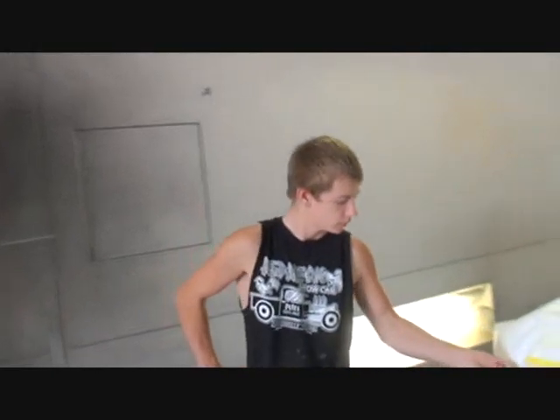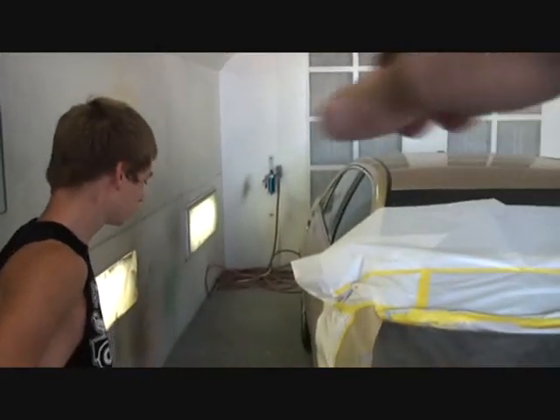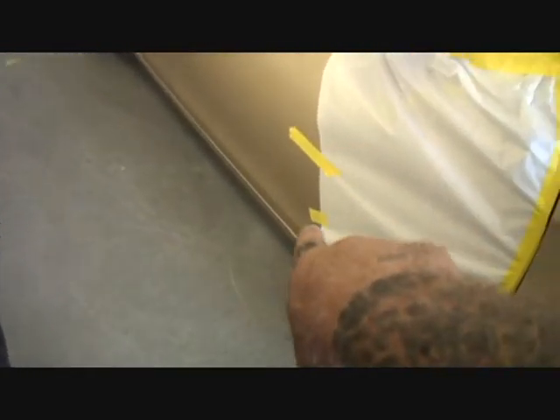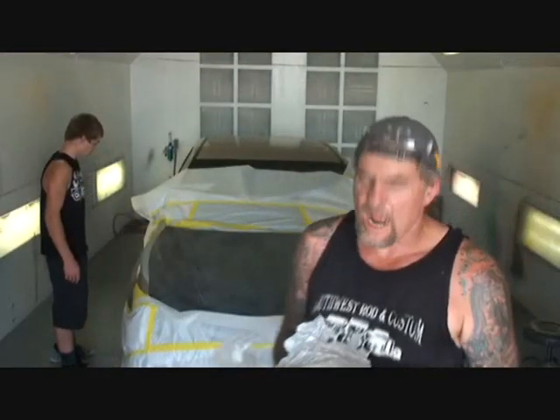Dylan, what did I just tell you to do and why? You've got to tape it out first with paper, and then use the plastic — because if you don't, when you go to paint it a second time it'll start flaking off. Exactly. Paint does not stick to this plastic because it has a silicone-type finish, so it's very important when plasticizing a car to outline everything first. Also, Dylan, you put tape on the door — we need to remove that tape because we're going to tuck the plastic under there instead.